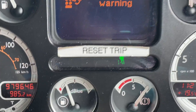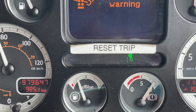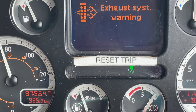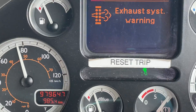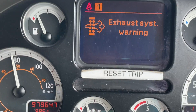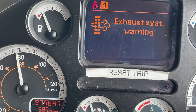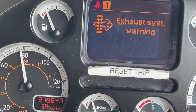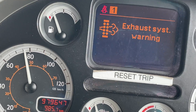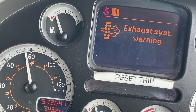The green button on the dashboard shows I'm in low split. I've engaged high but haven't yet dipped the clutch, so it hasn't gone into high. I dip the clutch — the light goes out, it goes into high, and I'm away. I pre-select low split again. Nothing comes up on the dashboard because until I dip the clutch, it won't select the gear.